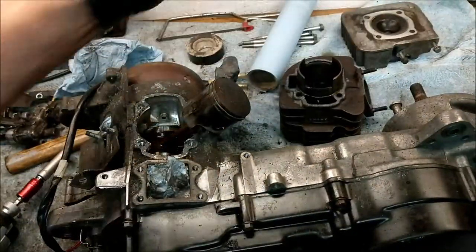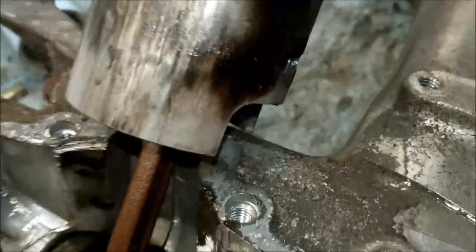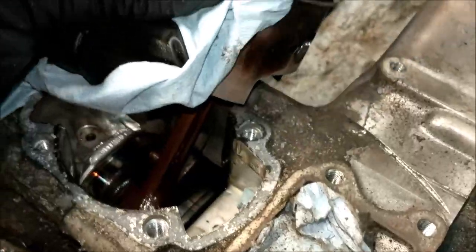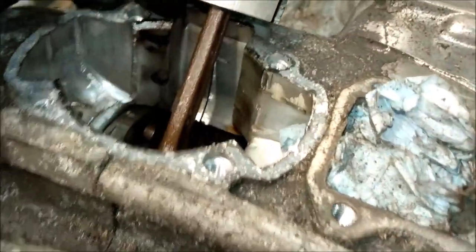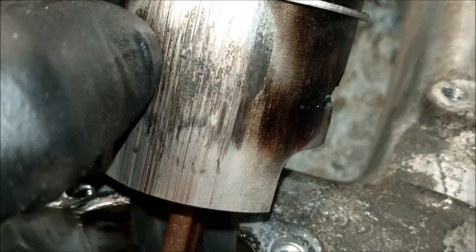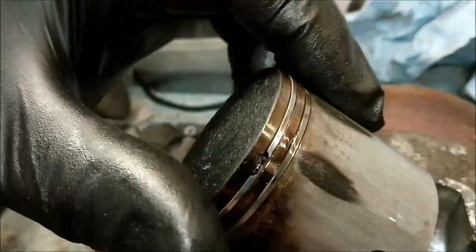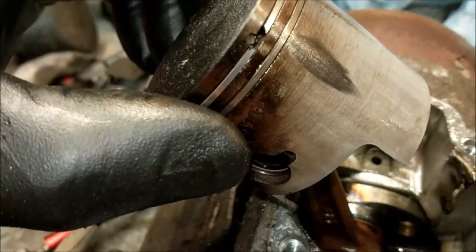Flipping heck. Right, let's take a look at the piston. Yeah, suspicions confirmed. Lovely loose rings, look, that's really good. So I don't need to get new rings from a new piston oversized kit. I sounded like that bloody owl then, from Bagpuss. Right. Yeah, that is just downright bloody horrible, isn't it? Horrible. Bit of piston slap. Horrible. Inlet side. Not too bad. But still signs of wear going on there.